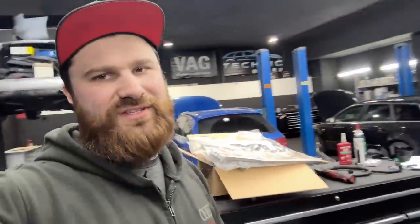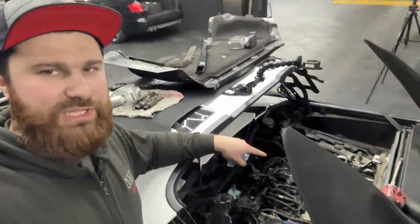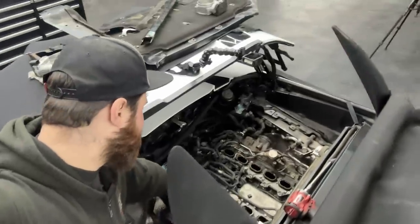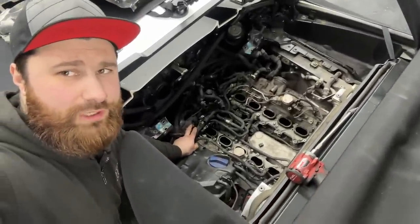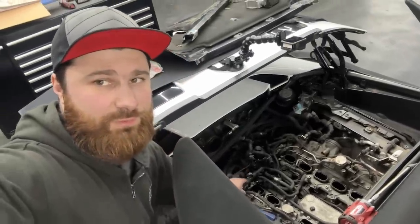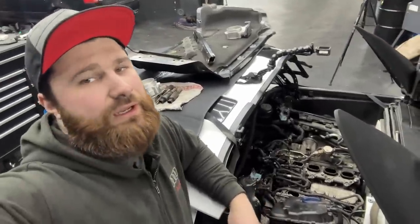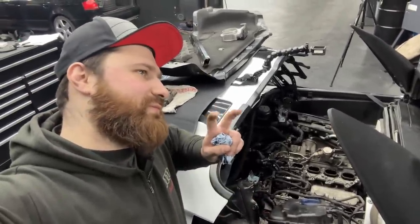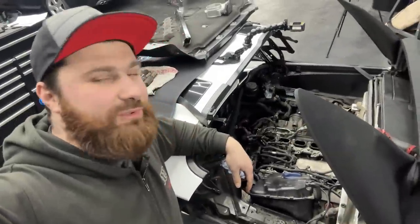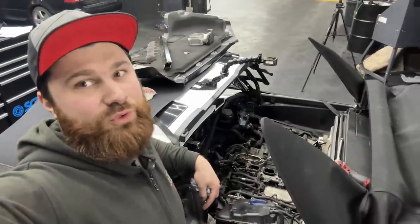So smoky testy. And yeah, we have to get to the intake valve, so that means the runner flaps have to be removed. We did also find that this connector is not broken, but the wiring is a bit old and starting to crack, so that will be sorted as well, and generally cleaned up. I can't really wait to do the carbon cleaning on the valves, because the access is terrible and at the end of the day my back will definitely hurt. But you gotta do what you gotta do.